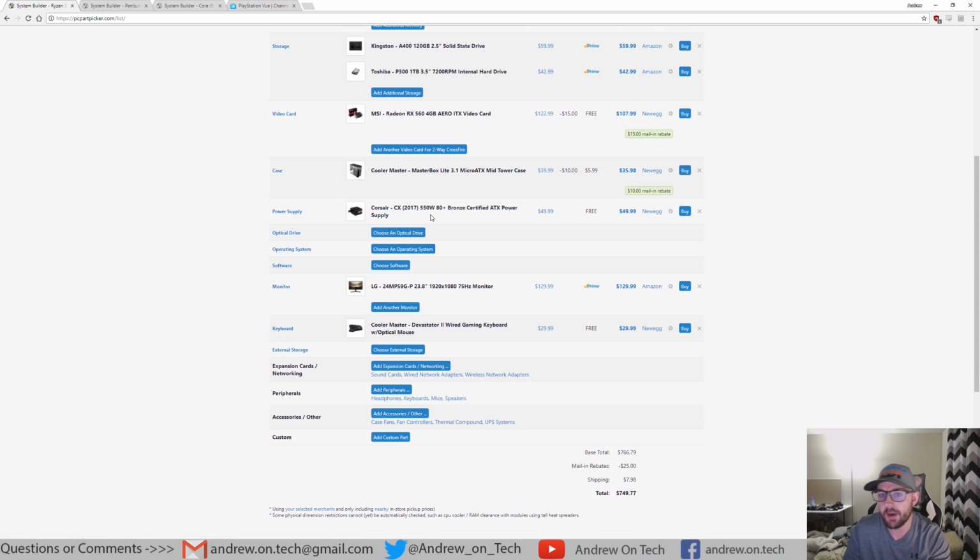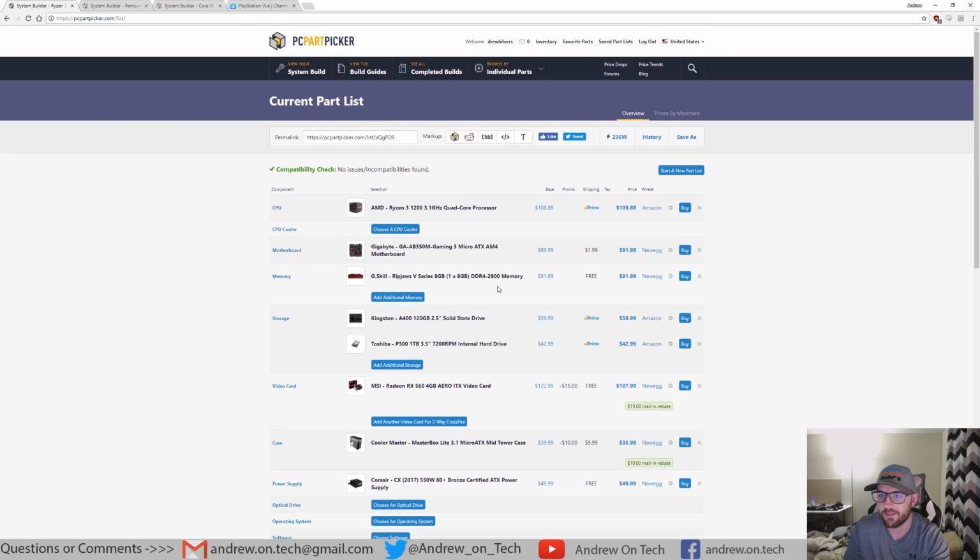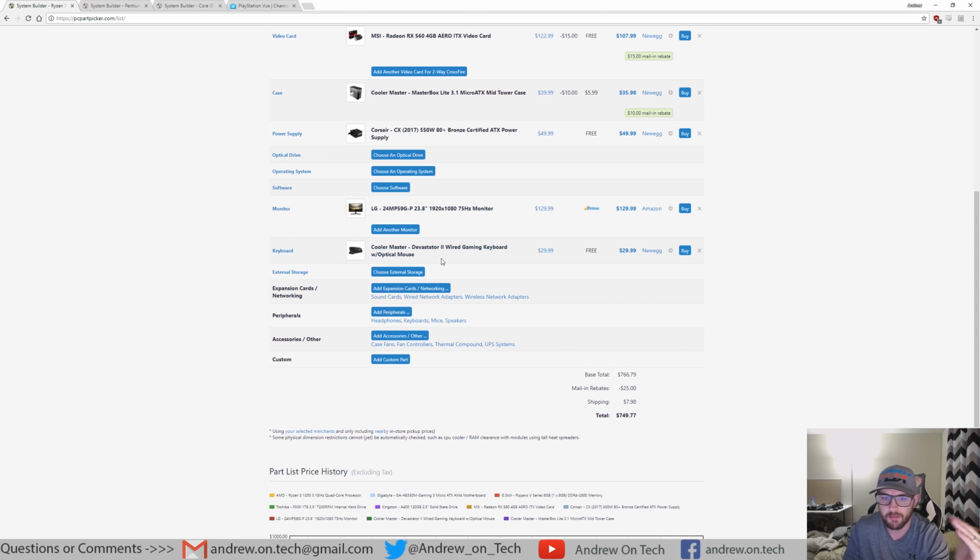For power supply, I pretty much went with the best 80 plus bronze that I could get for the budget, which was 550 watts. So I think I paid $29.99 or something like that for it on Black Friday. But again, Corsair makes good power supplies. It's 80 plus bronze, 550 watts, should be plenty for this build. PC Part Picker recommends 236. So yeah, perfectly good on that.